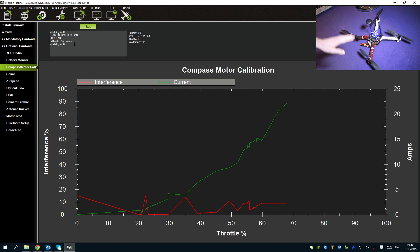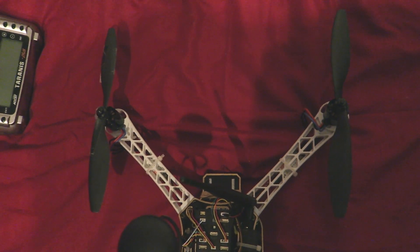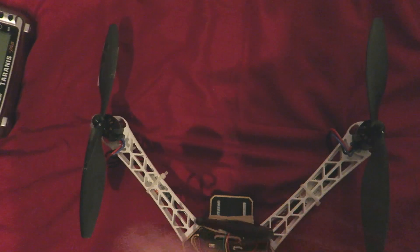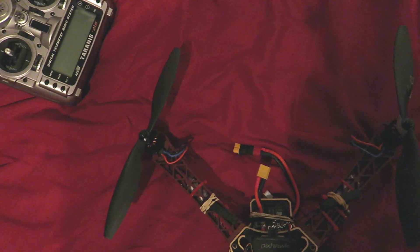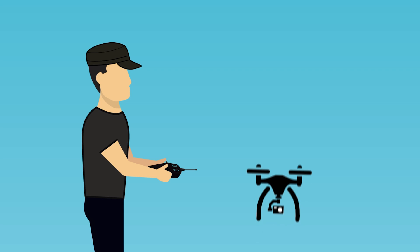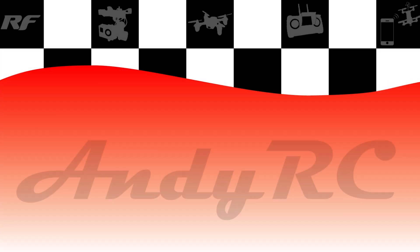Now we're ready to fly - we just need to put the propellers back on the correct way around. Here's a quick tip for knowing which way to orient your props: with the quadcopter facing forward and two blades pointing outward, you can see each blade has a kink that curves outward. The same should apply on all arms - that kink always curves outward from center. That's episode seven - join me in the next video where we set up and fly the quadcopter. Thanks so much for watching, please subscribe.